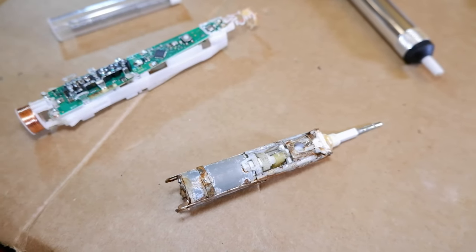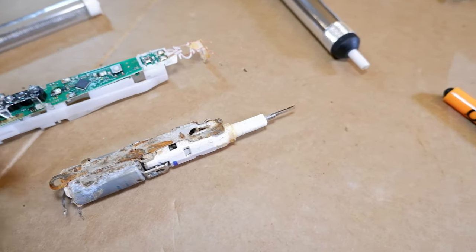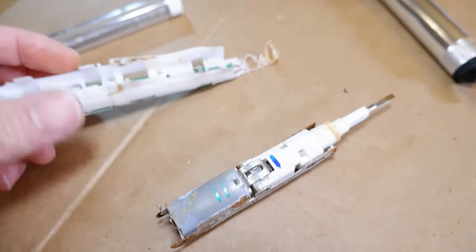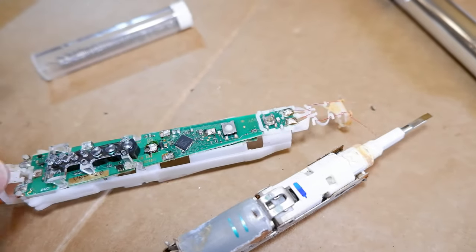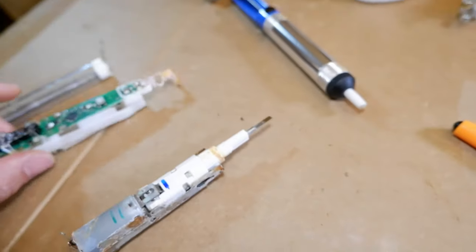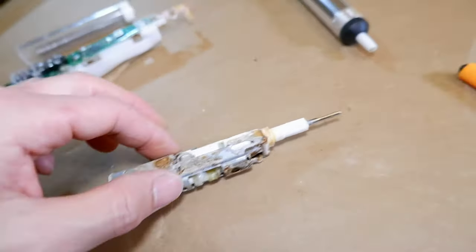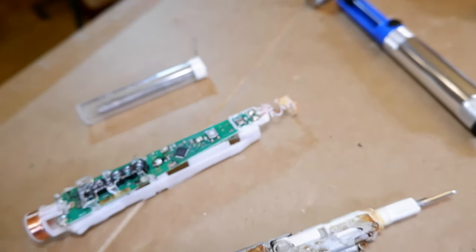On the broken, rusted unit: I desoldered it and it's really just held on by two connection points. I also accidentally desoldered a third point in the middle — that turned out to be the pressure sensor that warns you when you're brushing too hard, so I'll re-solder that back since it doesn't need to be removed for cleanup. I'll clean up all this corrosion with white vinegar, then spray it down with more vinegar and use steel wool to scrub off the surface rust. Once done, I'll replace the corroded LED and put everything back together.